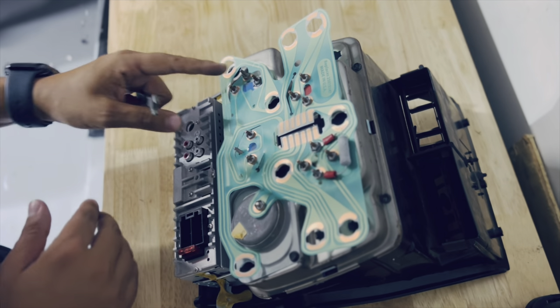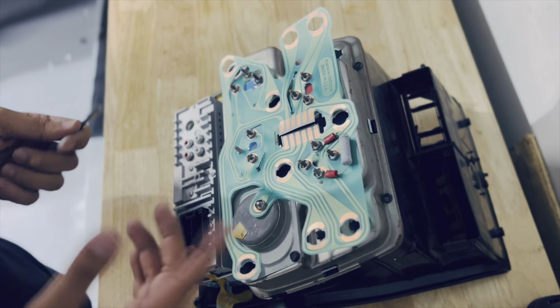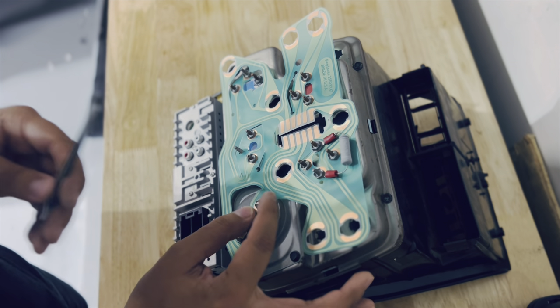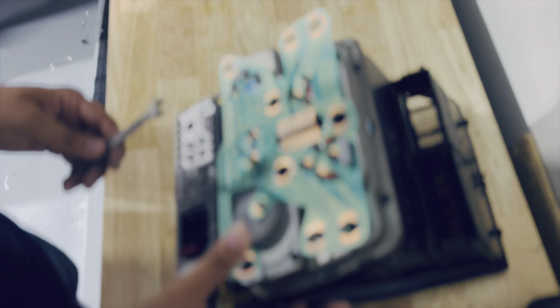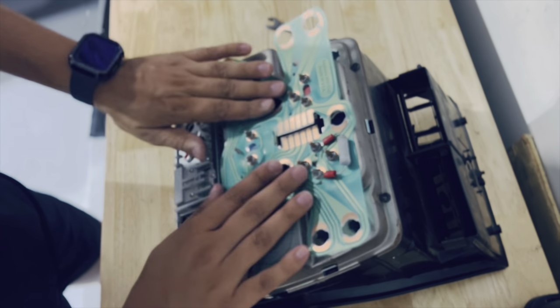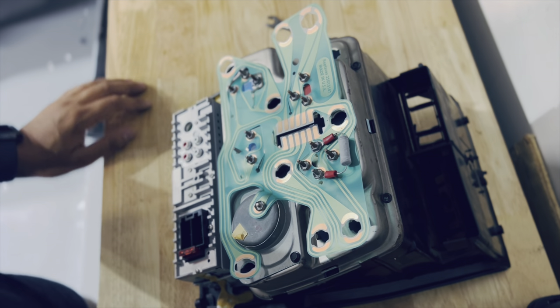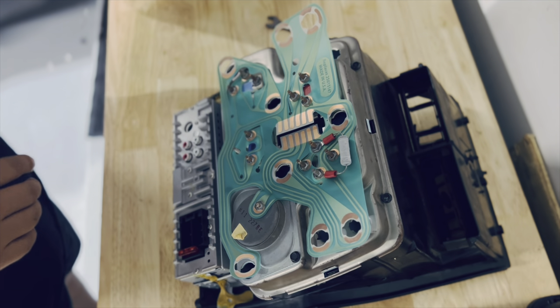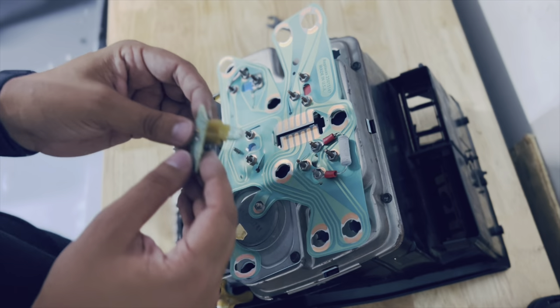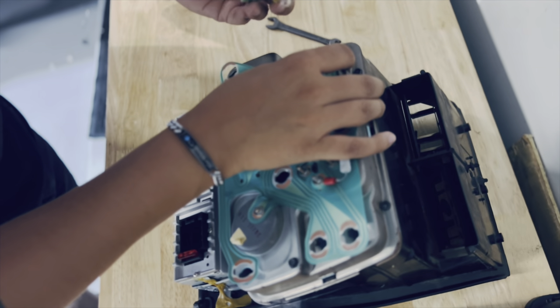We're done tying every single screw — this one didn't have one, which explains why. Let's go ahead and tie it up very gently; let's not overdo it. Looks pretty good. Now let's get on with the rest and start adding the bulbs back. Remember, the one with the giant connection is for the low fuel indicator, so that one goes back in its spot.